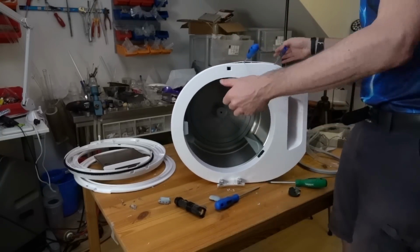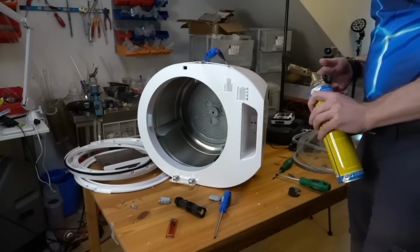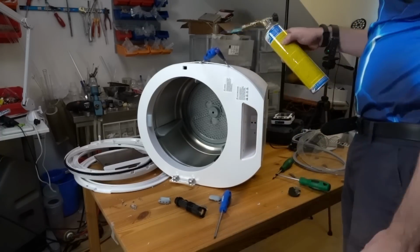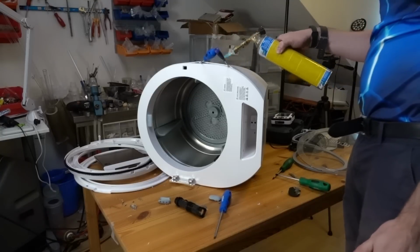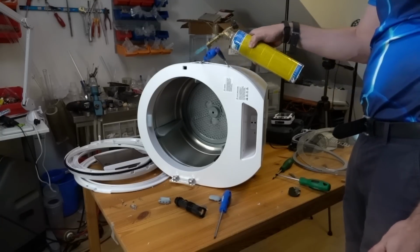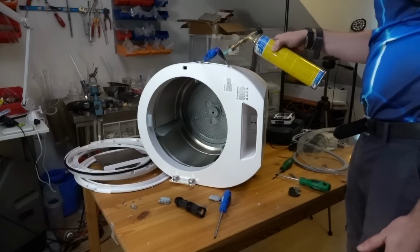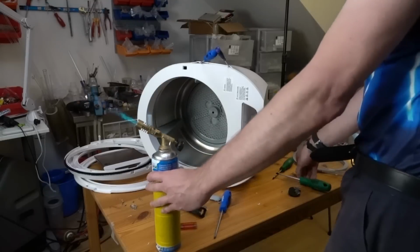I think this calls for a more unorthodox solution. Right, so not a lot of people would know this, but polyethylene gets fairly soft at about 150 degrees. So if you actually want to get into something like this, just to take a look on the inside, I'm going to cut this bit out here. But first of all, I need to soften it up. I need to cook the plastic just a little. Get it up to the point where I can basically cut it with a spatula, not a spatula, a scalpel.